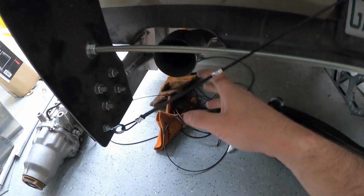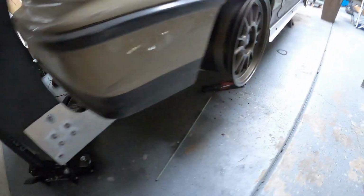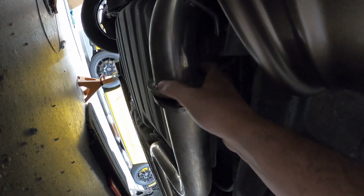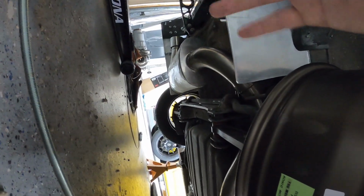I don't really wanna modify the thermal 3-inch, so what I'm gonna do is add a V-band. I've already unbolted it, and obviously if I want to go back and forth, I've got this 3-bolt flange, changing gaskets. So I'm just going to add a V-band here and here, and make a whole new pipe section. It's basically just going to be a straight pipe, and the turbo will be the only muffler. So the car might sound a little more rowdy on the track. It's pretty quiet now. Not a huge ordeal, but we'll see where this goes.